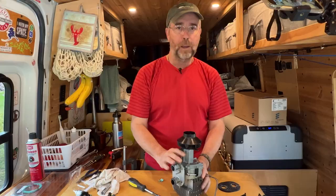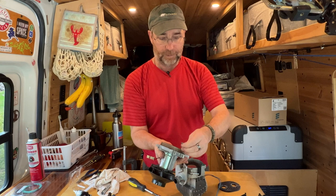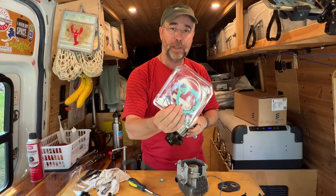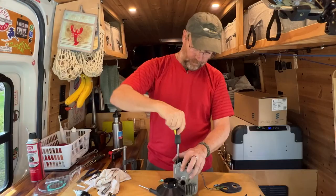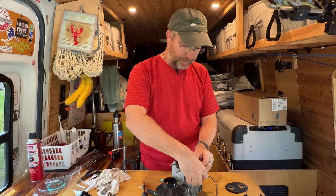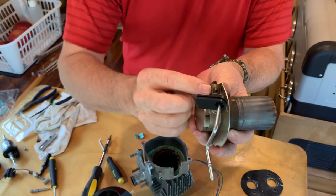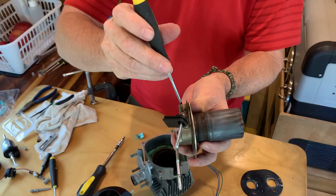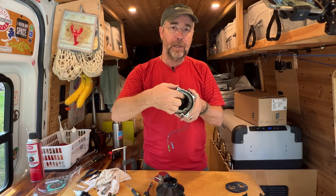Once you've removed those four screws, this end will come off and probably break your gasket — so make sure you've picked up a gasket kit. All of this stuff is going to be linked below in the description. Next, there are three screws in here, also T25s — you want to remove those. Once you've got those out, you can begin pulling the burn chamber out of the housing. There's a rubber boot on the side where the fuel hose goes into the burn chamber — you need to pull that up with it. And there's your burn chamber. Right here on this side you can see that hole — this is where the atomizer screen goes and this is the hole you want to make sure is very clean. There's a gasket in here you have to replace as well.